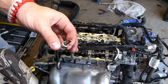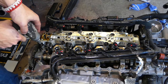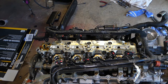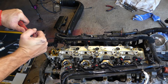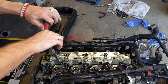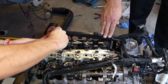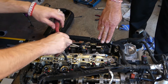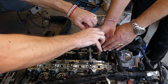We need a six-millimeter allen wrench now. Right here we have a few bolts that we'll need to remove by hand — they look extremely tight. I'll break them loose by hand first, then use the impact to save time. We have torque specs in the engine videos, so you'll know what to expect. Make sure the wrench goes all the way in because those allen heads are super easy to strip.